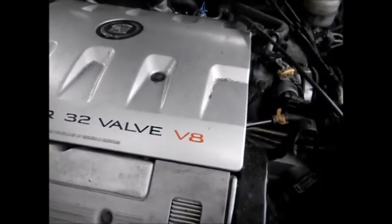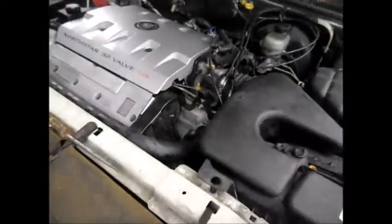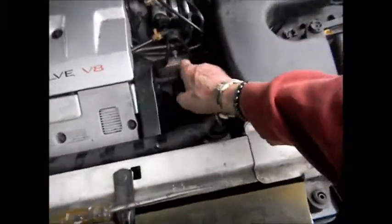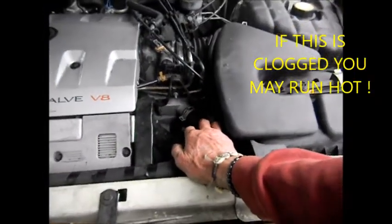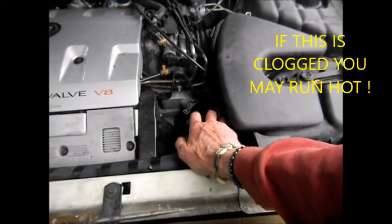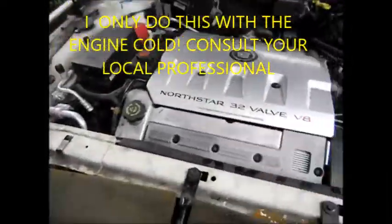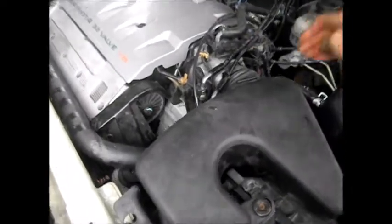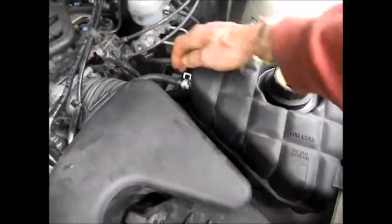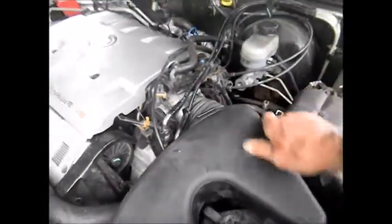Okay, so here's the North Star. I'm going to tell you how to check this tube here — this is a small circulation tube for the radiator. It goes underneath here and through here, and it helps remove bubbles if the system needs to be purged. Some of them actually have this tube. One way to check it: with the machine cold, take this tube off, take your cap off, blow into the tube, and if you hear it bubbling in here, you know that tube is clear.